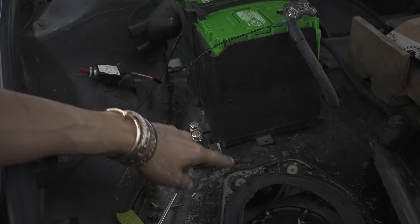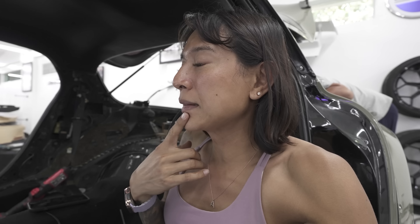So that is the outlet — it comes out of there, goes into the oil cooler, goes into your oil filter, and then goes into that batch section. We just got some instructions: this is the in, that's the out — so water has to go in there, water has to come out there, and then this oil line right here plugs straight back up in there, and then this one goes out into the oil cooler, the oil cooler goes into the oil filter, and the oil filter returns back in there. This is the breather — gotta remember all that.